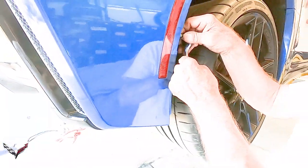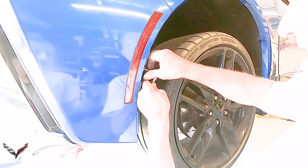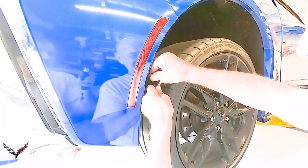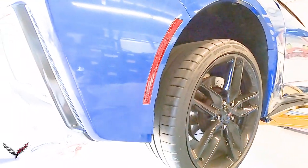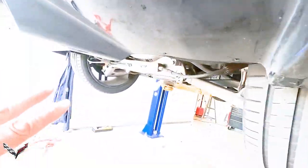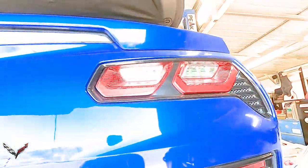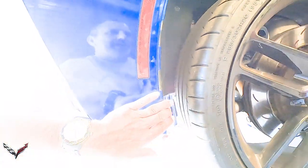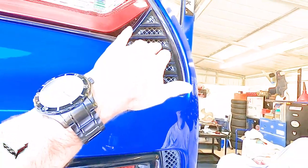I know it seems like a daunting task, but it's not hard — you just need to take your time. If you follow this video step-by-step, you'll be able to do this yourself. To recap: we've got all the screws out of the bottom of the car, the two screws from underneath by the exhaust, all the screws across the top underneath the trunk lid, the trim piece, and our two T15 Torx out of each side. The only thing holding this bumper on now is the T15 Torx hidden up behind this vent.